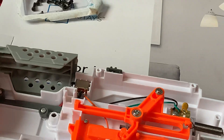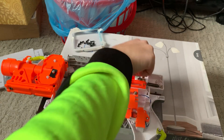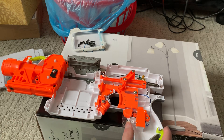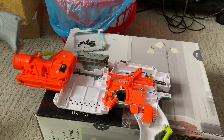So that's how you do it — that's what it's supposed to look like. That's all you've got to do: just twist it. But remember, you just have to go slow — just slowly twist it piece by piece. If it starts to look like it's cracking, stop. If the wire looks like it's going to break, or the wire feels much weaker, or the thermostat — just stop. Don't go any further if you're experiencing any issues, because the last thing you want to do is break the thermostat and not be able to fix it afterwards.